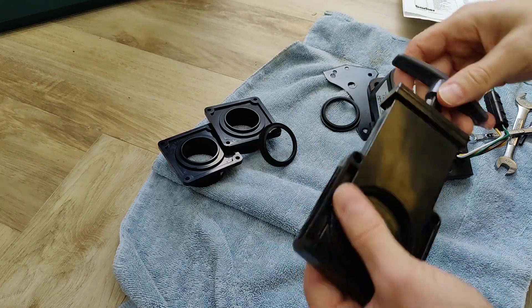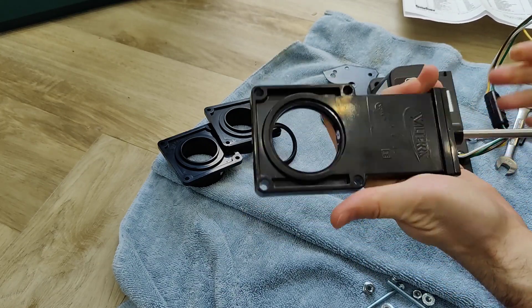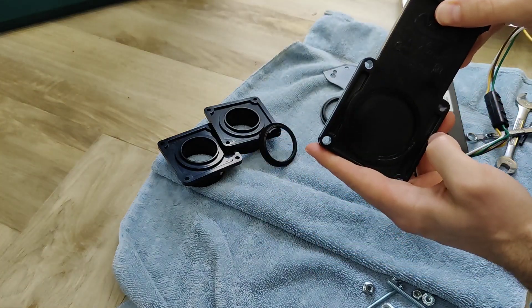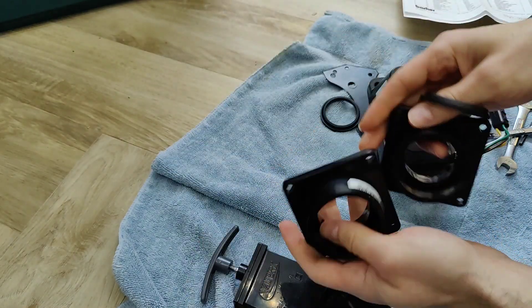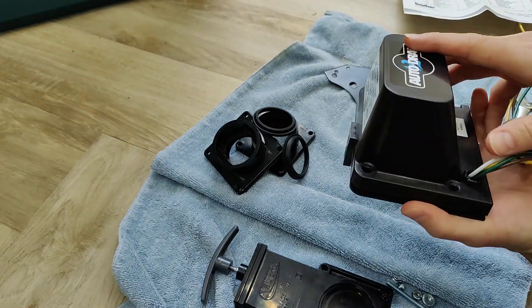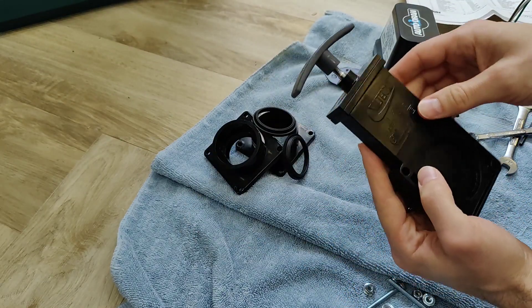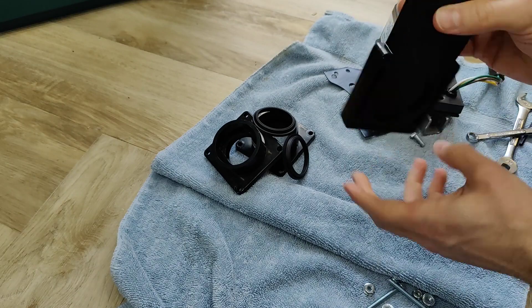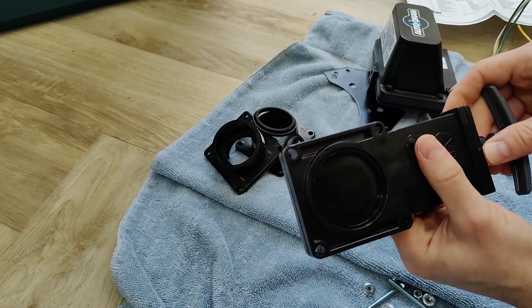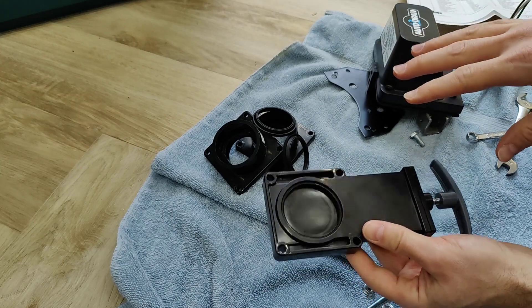Today what we're going to be doing is fitting together everything for the gate valve. This is for the gray water tanks — this is how we're going to remove all the water from the tanks. This holds all that water back, so we have to put this thing together. This comes with some slip sockets, which actually had to be ordered separately, as well as this device right here, which actually opens up the gate valve for us. We push a button and that'll open up and release all the water, which is a pretty nice feature. As with everything on an Airstream, it's really small, really tight spaces, but I think we can get everything to fit.